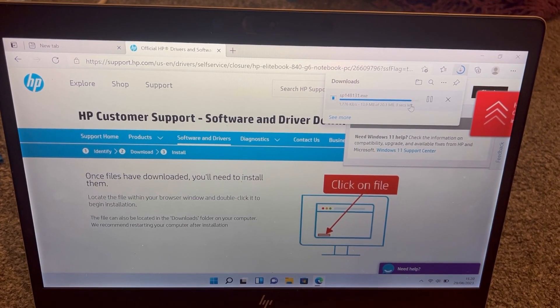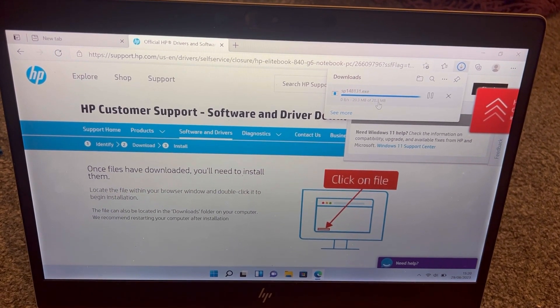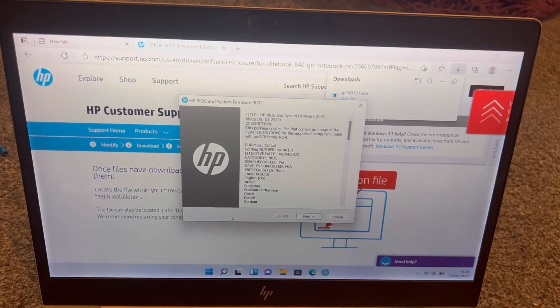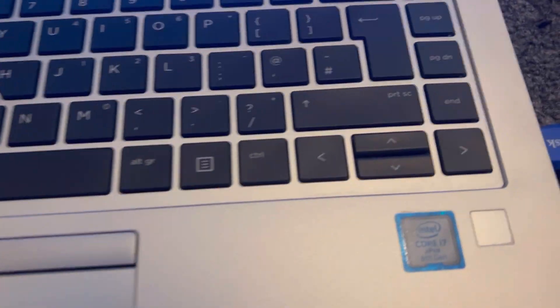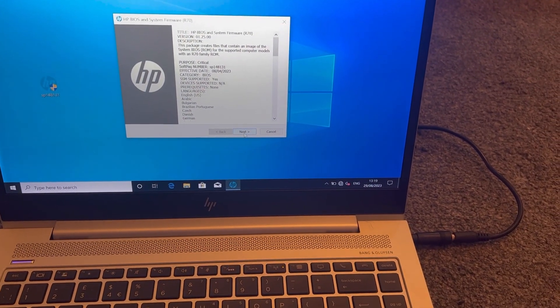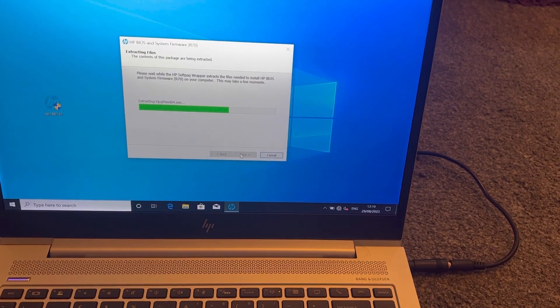It's quick by the way — it's about 20 megabytes. Once that's downloaded onto your desktop, click on the link. Make sure your power cord is on, otherwise it's not going to work. Make sure your power cord is plugged in at all times when you update the driver. We're going to double click and flash the firmware. In this instance, the Intel Management Engine firmware is corrupted, so just follow the procedures to flash the firmware — the whole BIOS actually.